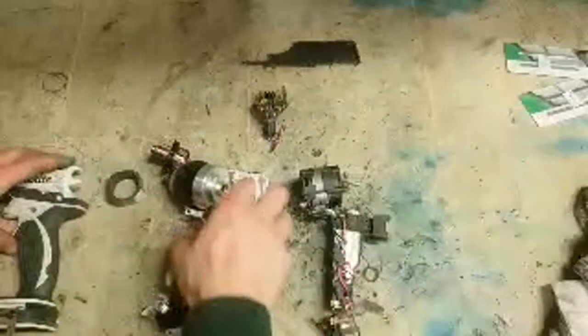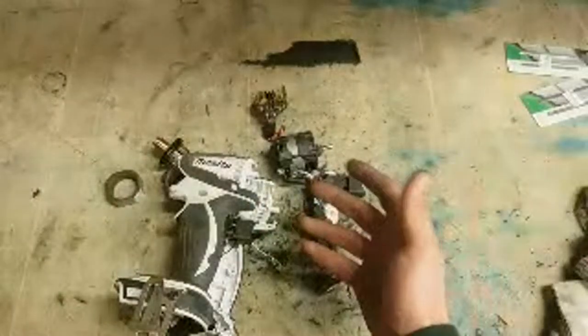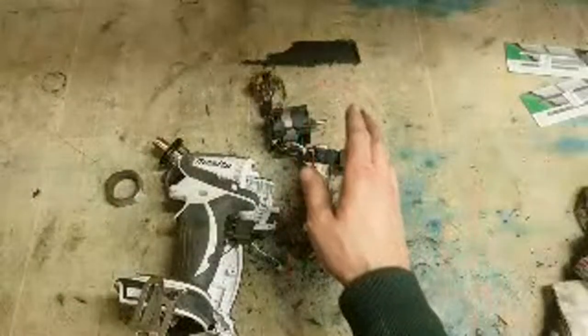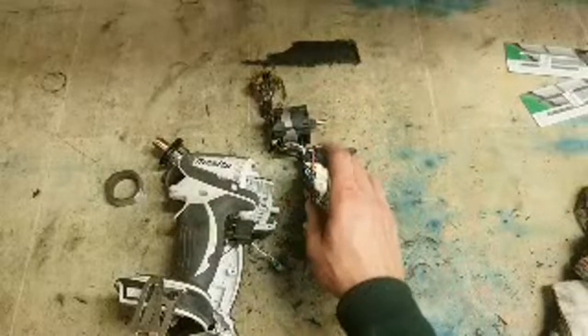You get more time out of a brush machine if it's looked after. A brushless machine just takes one component inside the controller to fail. That's it. Gone. Certain brands are better than other ones. Makita, Hikoki, Metabo. Generally, they will sell the motors as different segments, different pieces. So the field will be separate, the rotor will be separate, switch, controller. They can all buy individual pieces. It doesn't really matter. The main thing that goes in a brushless machine is the controller.